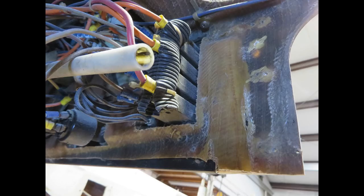The back side of that wall where I was just trimming should look like this when you're finished. The reinforcing block of wood has been cut out and removed, and the area has been surface sanded to make it smooth. This is to allow the aluminum flat bar on the new L-seat modification to fit up behind here and have a smooth surface to be bolted to.